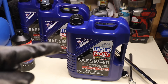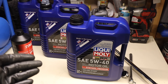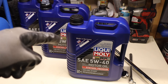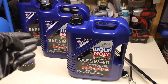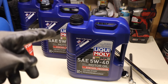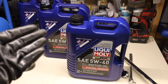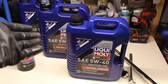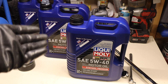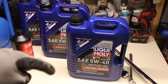The person I bought these oils from was very knowledgeable on Audis and VWs. The VW Audi approved oil is actually thinner for fuel consumption — it can leak more into your oil on cold start and cause more puffs out the back; it's just thinner for fuel efficiency and EPA regulations. The Liqui Moly Synth Oil Premium — at a quick glance you might think it's VW Audi approved but it's not. When you look carefully it's VW Audi recommended by Liqui Moly, and this stuff is thicker, which is likely why I'm not getting my puff of smoke out the back.